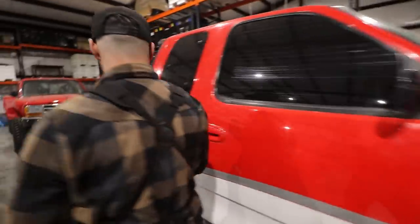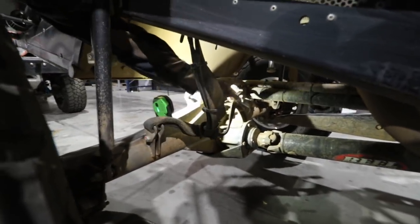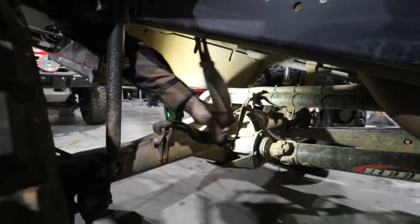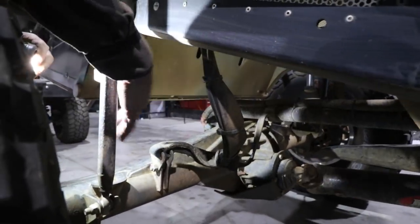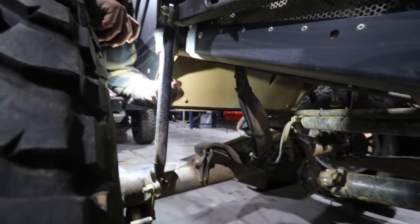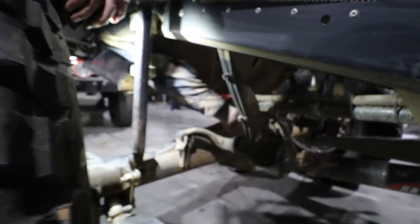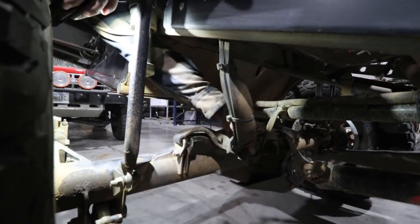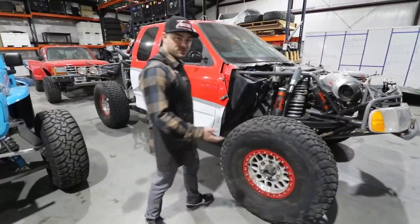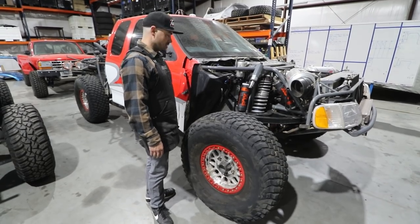We can check out the rear of this thing — traditional four-link setup, same thing. You have double straps, and then you have a bungee setup that is connected to his upper link per side. So when this droops, it keeps it tight, but when it compresses back, it doesn't let the strap get wild and come back to the bump zone — where your bump is hitting the strike pad, you're not getting anywhere close to where things start binding and fail. This is a really good idea if you have big travel trucks. Get these things isolated where they stay in their home.